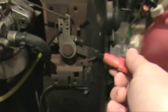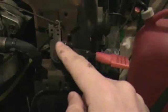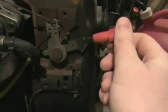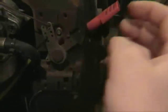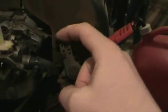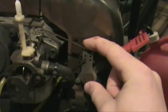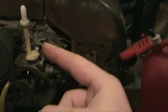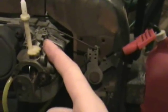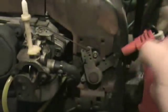And with this arm right here, you move a mechanism that you can see is behind this plate. There's a spring that pulls against this arm when it's all the way up. What happens is the engine comes up to speed, it pushes back and closes the throttle. You can see the throttle arm right here. What's happening is — you can tell when I let go with my finger — it sticks. It doesn't move smoothly at all.